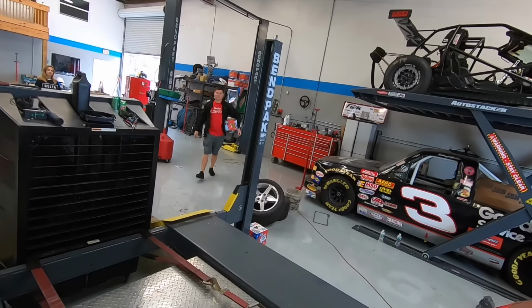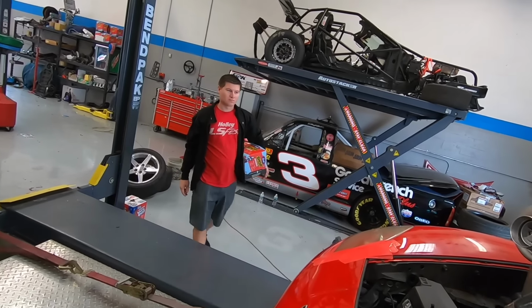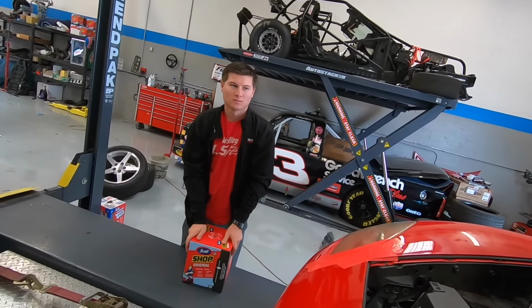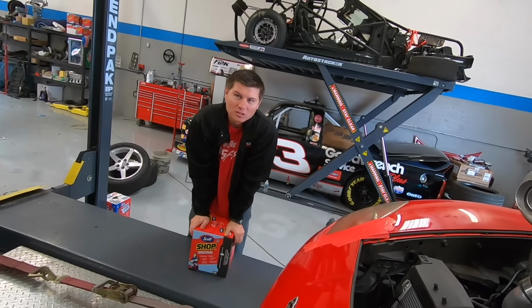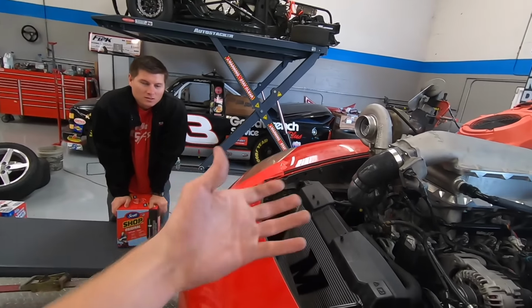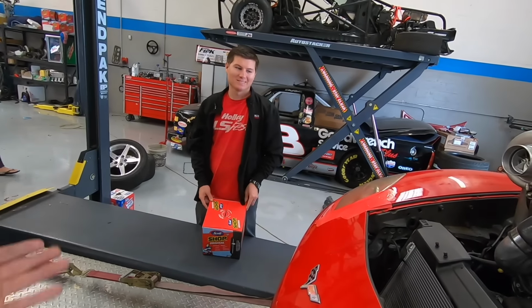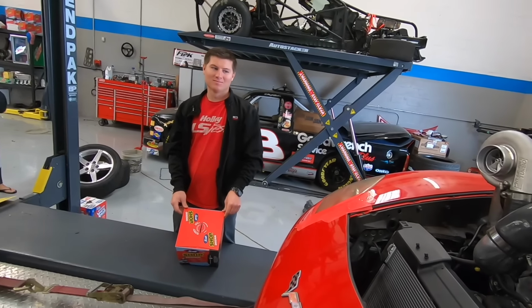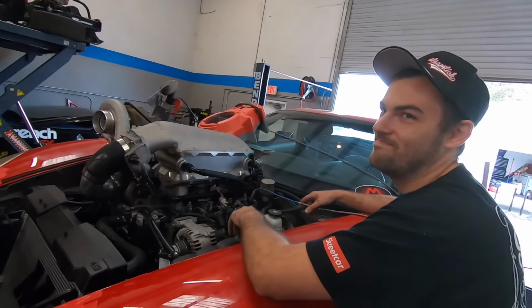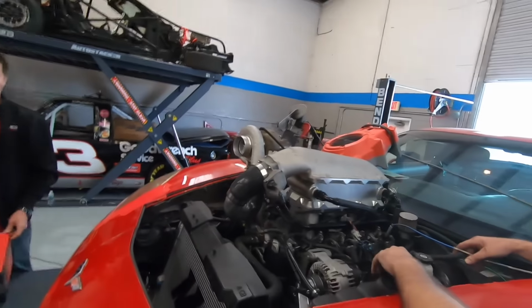In first gear still. All he did was lean it out from the last pull. It took 13% fuel away from it, and it liked it a lot. But when do we get up to boost a little? We're still in first gear, so once we go into second, it's just going to pick up boost because of the higher load. So if it's making over 800, we just leave it, right? And bring a boost controller to Houston if we have to. Turn it up there.